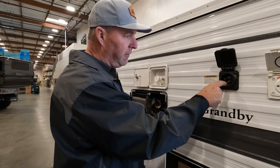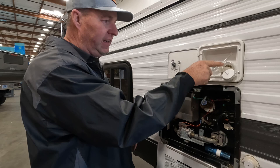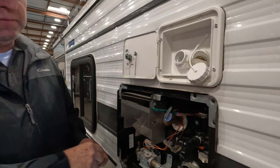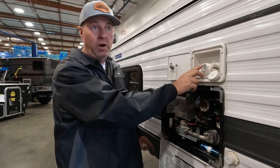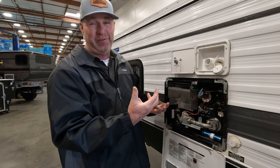The water filler fills the fresh water tank. Ideally for maintenance, drain your water tank when not in use — just get the old water out and leave it empty. Winterize the system if you're in cold weather. For fresh water, a lot of people use a couple of tablespoons of bleach or an RV water freshener or RV water sanitizer to keep the water free from bacteria.